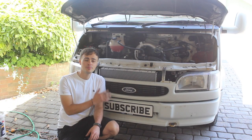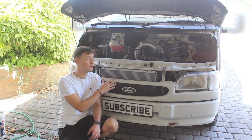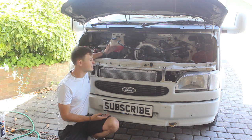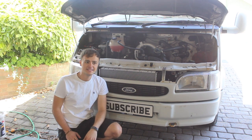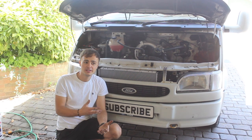That's the cooling system completely flushed out. We've got a brand new radiator, brand new thermostat housing with a new seal, so less points of failure. As you can see, it's so clean in here now and the engine's been running. That should hopefully stay clean, providing we don't let any air or any water get in the system.